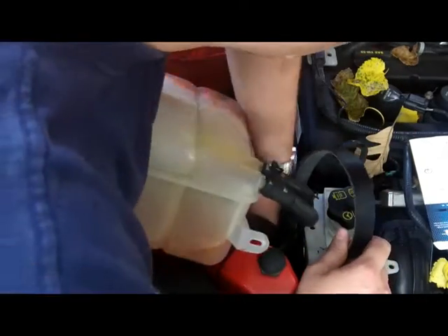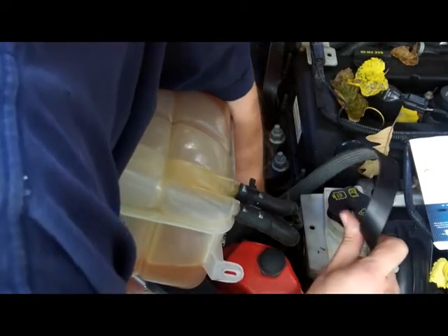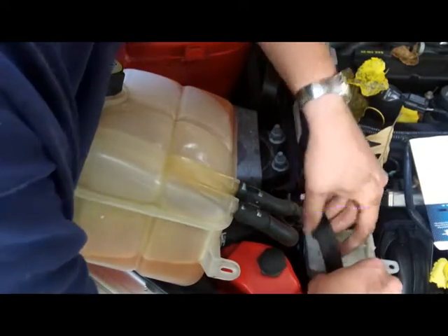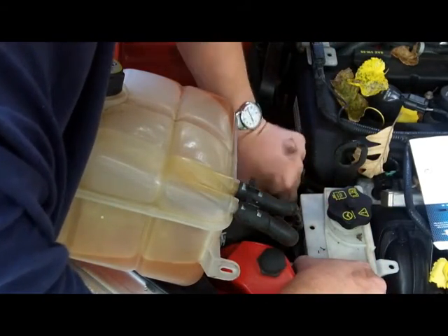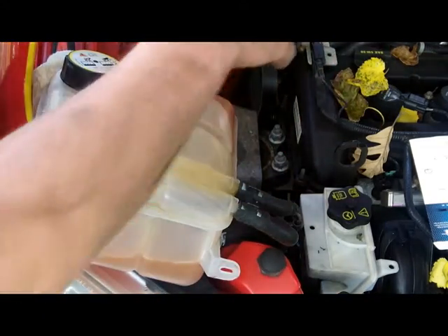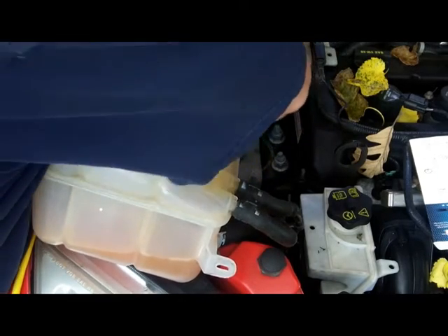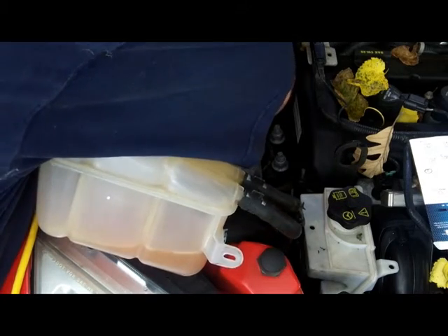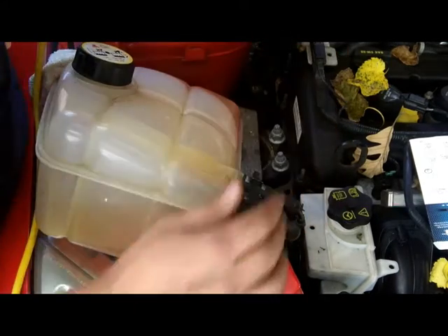Just go ahead and slip it in — you'll find you can get it around almost all the wheels except for one. I chose not to put it around the bottom driving pulley, but you can slip it around all the others. Once you've got it draped over the top of the wheels and it's generally around the wheels, you can go underneath and start manipulating the belt, pushing it over the water pump pulley and configuring it the way you want. Once you've got it all wrapped around most of the pulleys you can start turning it by hand and see your wheels turning successfully.